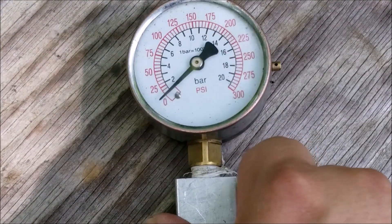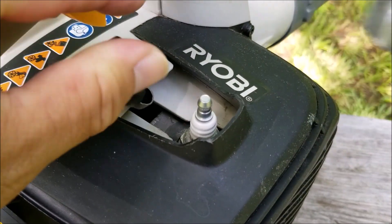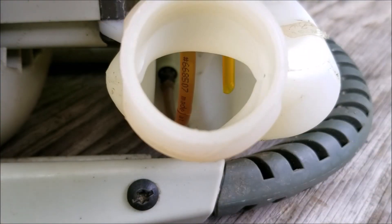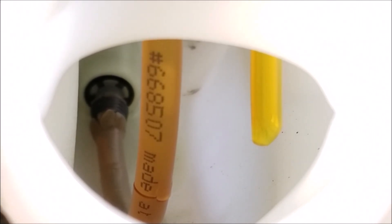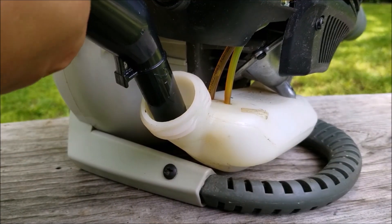The main reason for this blower to be slightly worn out is the wrong gas and oil mixture. A mixture that's low in oil will wear your engine down compared to the correct mixture. There's still some fuel in the tank and if you look at it you can see there's very little color to it, which confirms why this engine is a bit worn out — there simply isn't enough oil in the gas. The next thing I'm going to do is put some fresh fuel in the tank and prime the fuel system and try starting it.